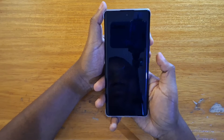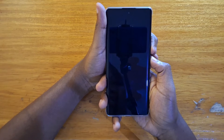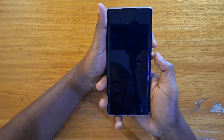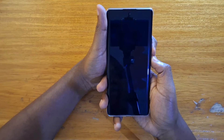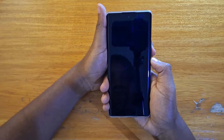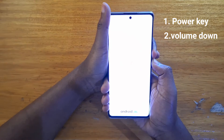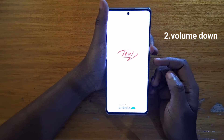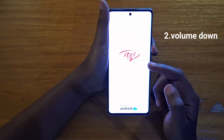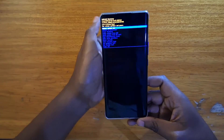So that's what I'm going to do right now. I'm going to press down the power key, followed by volume down just after a second. Press down power key, followed by the volume down key. So let's do that — power key, count a second, volume down, release power key and keep holding volume down. Once the phone shows the white screen, just like that, and sure enough you'll be into recovery.